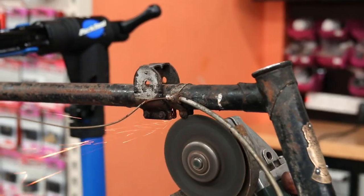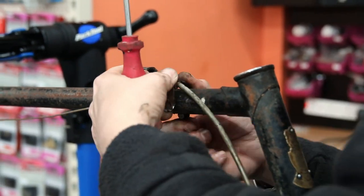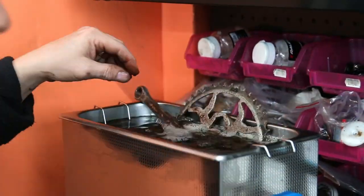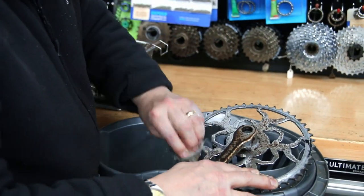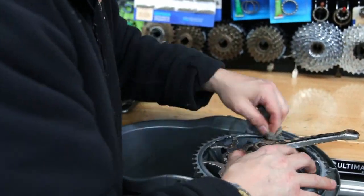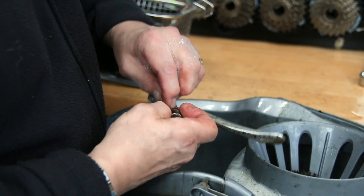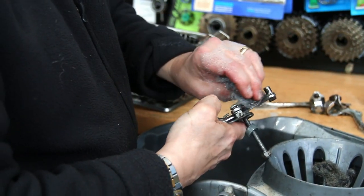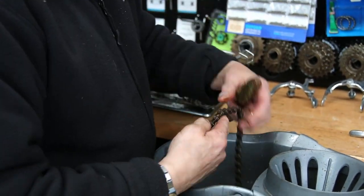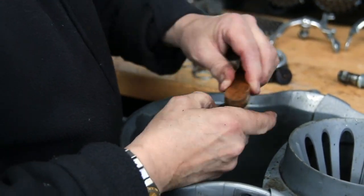These fittings at the front I wanted to keep. There was one mounted on the frame and I'm not really sure what it did — whether this bike had been converted from rod brakes to cable brakes, or what that fitting was. If you've got one of these old Humber bikes, please drop a comment to say what that is. Everything's now going through the ultrasonic cleaner, then we're using wire wool and soapy water to clean off the rust. We always detail around the rust — cleaning off the bleed of rust and then detailing what's left.